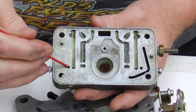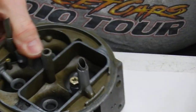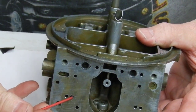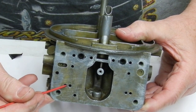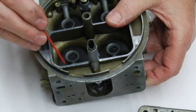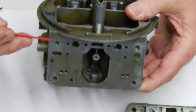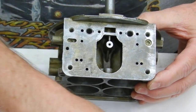The actual mixture screw is pulling fuel across to this hole, which in turn lines up with the transfer slot and the idle mixture hole. These are pulling air out of this bleed here in here, which is right here on the meter block.